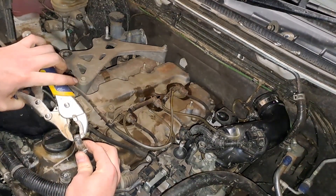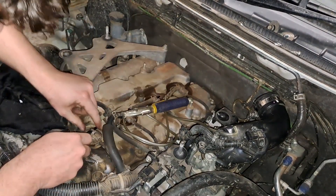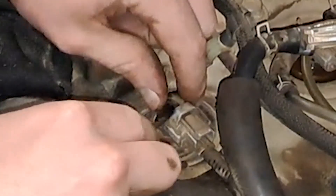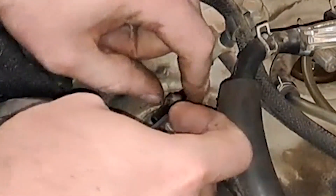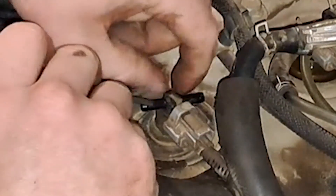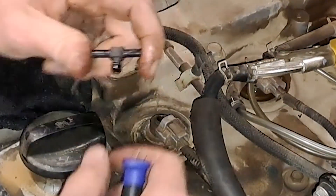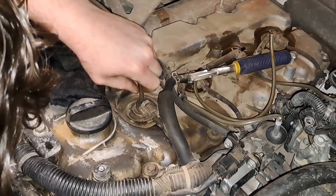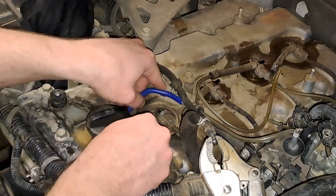Now the last portion of the main return line I just clamped shut — not sure if it would help or not, but I just did it to be safe. Now each one of these T-fittings on the injectors has a metal retaining clip that goes over the top of it. This you need to remove carefully — just pop it out on the sides and pop it over the actual tee piece, because you don't want to break that tee piece. In the worst case, you actually break that tee piece inside your injector. I ended up pushing the tee back and just blocking off one end of it with another pipe and a bolt inside that pipe.